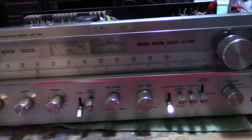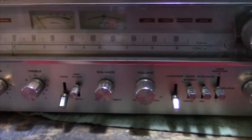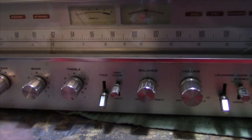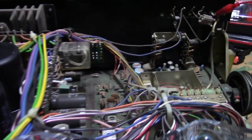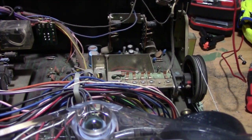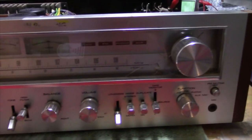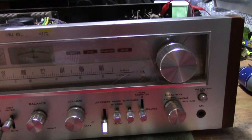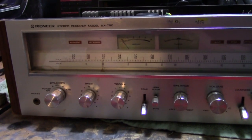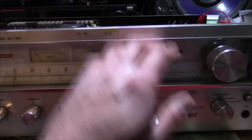I'm going to call that a successful test for now. I'm going to run this thing for a little while and play with it. Probably going to have to clean some controls, but they really don't sound too bad — there's not really much crackling in the controls. There's a little bit in the treble and the bass, but not that much considering how dirty this thing is inside. I did vacuum it out a little bit, but I've got to give that tuner a good blowing out and probably hit it with some contact cleaner. There's no good reason why the power cord was cut, but this was a nice find for $50.